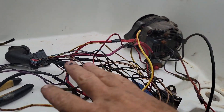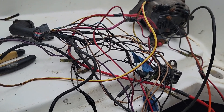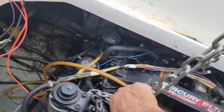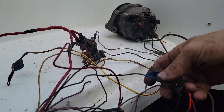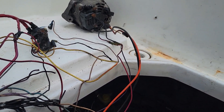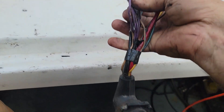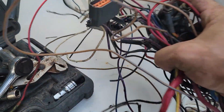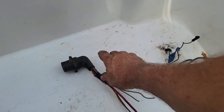Down here working on the wiring — this is the harness right off the 5.7 liter, what a mess. Look what a nice clean setup the diesel has, even with it unwrapped — super clean. This is the whole harness coming off the diesel engine, and this is the plug that was cut out of the other boat back in Boston that went up to the dash. The 5.7 plug connects here, so I just need to make a little adapter going from here to here using this plug. I'll eliminate all the wires I know off the bat are not needed for this diesel, clip everything down, and make up a quality pigtail from what's left.